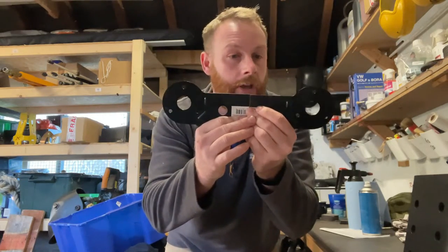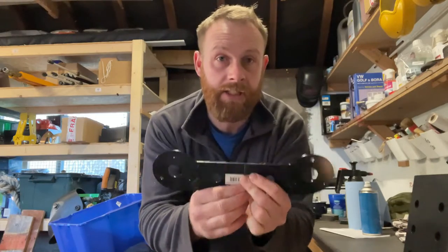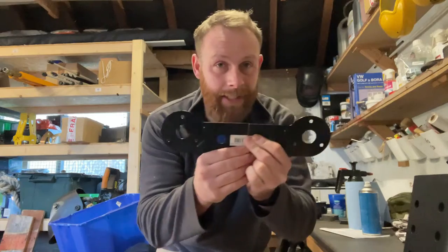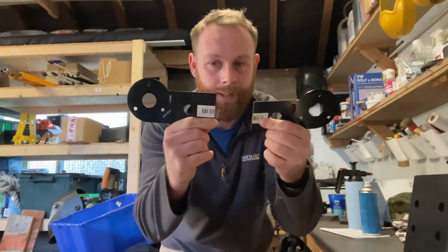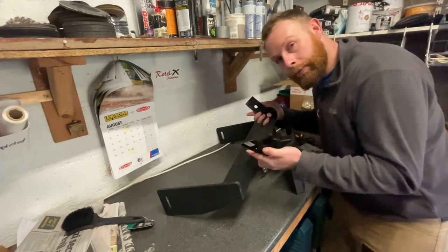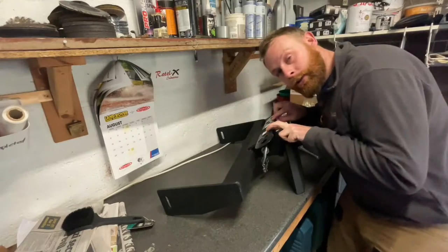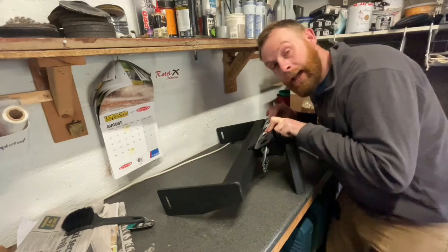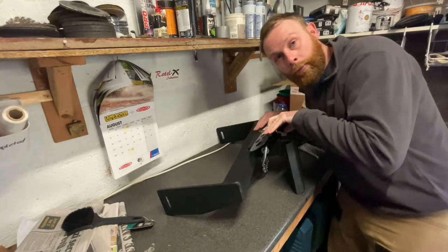It's just a normal plate that you get off any tow bar sales place. I got it off eBay, cost me a fiver. It doesn't actually fit the tow bar where I want it to go, so I've cut it in half. So the plan is to mount this onto the vehicle, but mount these in them holes there like that, so the electric points will fit either side of the tow bar and they'll be tucked up out of the way for when this drop plate isn't attached.